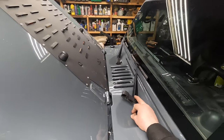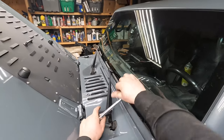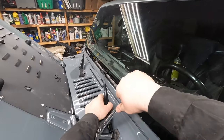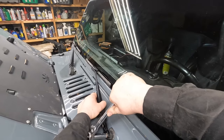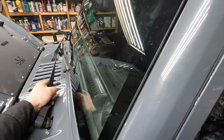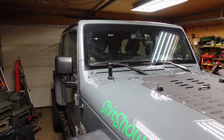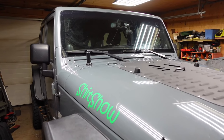The only thing you can screw up here is, because it is tapered, if it's not tight enough — better watch the glass, you will screw things up. It looks like I'm pretty tight there. That was pretty simple to get the wiper arms off and on.